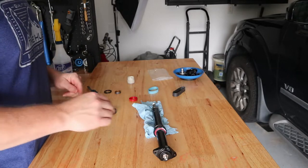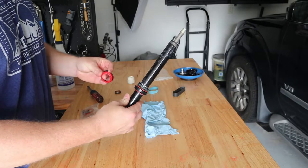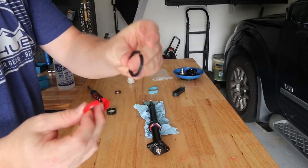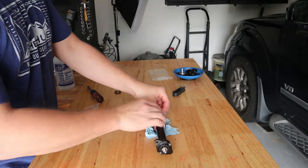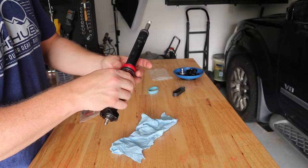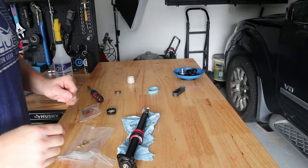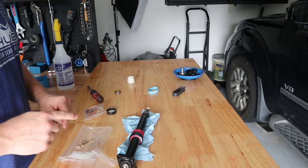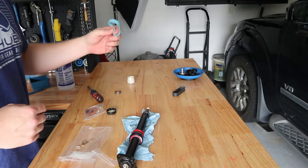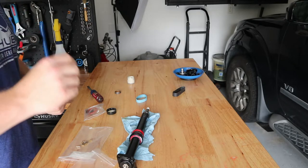To mitigate the risk of damaging my new collar and new seal support ring and foam ring, I just cut a slit into the old wiper and X-ring and put these two around the shaft. Hopefully as I apply pressure to just get it started, there's enough wiggle room and I'll take these off as I slide it down. Getting these keys seated in with grease and then trying to hold all of that while you have grease on it with a rubber band, get it lined up into the keyholes and ease it in without damaging anything — that has been the crux.